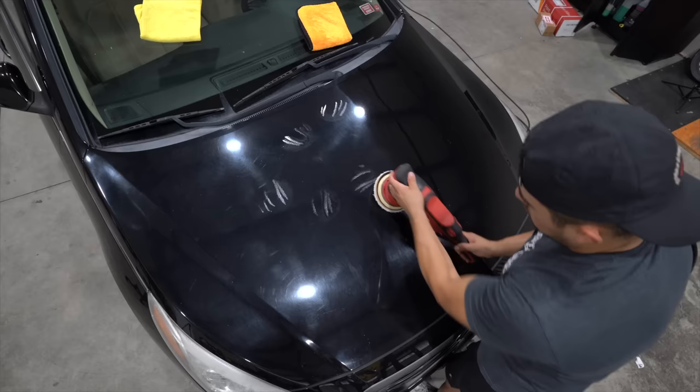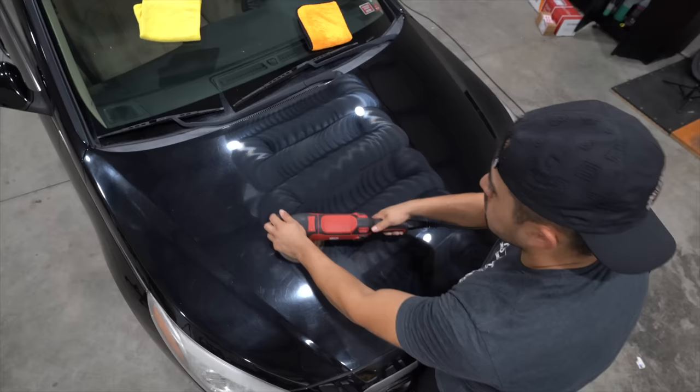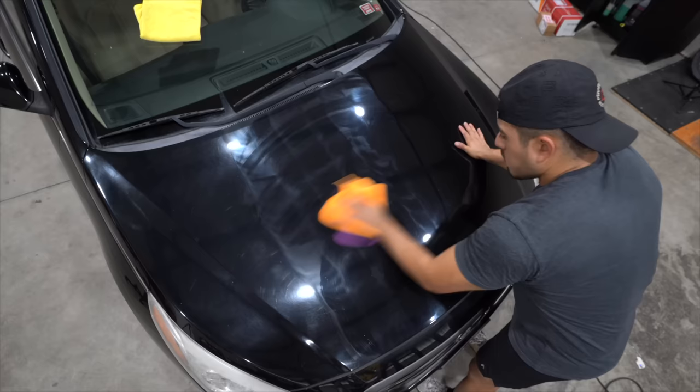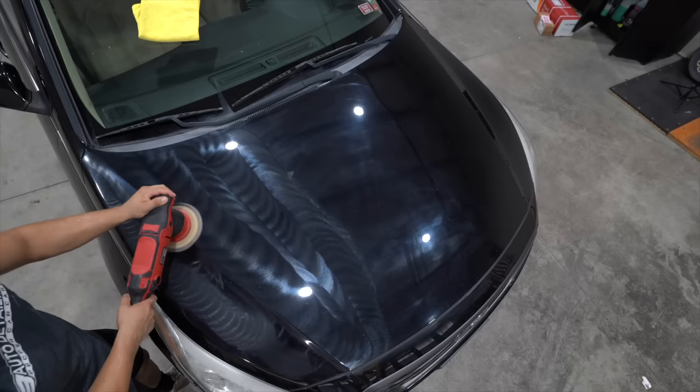Here's a great example of the compound drying out because this paint is pretty trashed. Some clear coat is chipping from the front, there's some crow's feet here and there — the paint just isn't in the best condition. As I'm wiping it off, it's literally just sticking to the paintwork. With this kind of paint drying out, I'm not going to spend time trying to wipe it off. I know if I just keep on working, I can quickly go over that dry area with the compound and it's going to come off super easy.